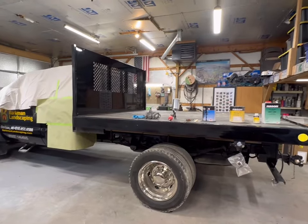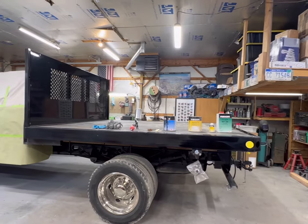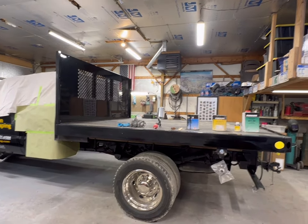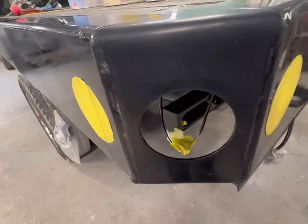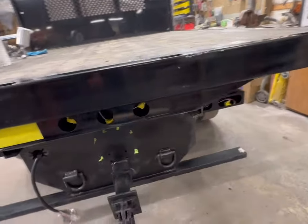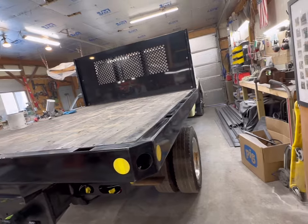Okay, bring it back right before paint. So you can see we're still drying in a couple spots, the wax and grease remover is, but otherwise I have scuffed and masked everything. All of our wire harnesses are taped off. All of our reflectors, our bolts, these threads we want to protect, all that's done. Everything's scuffed that I'm going to scuff.